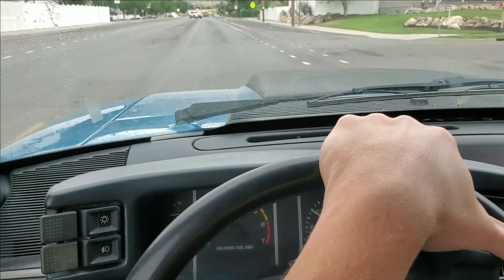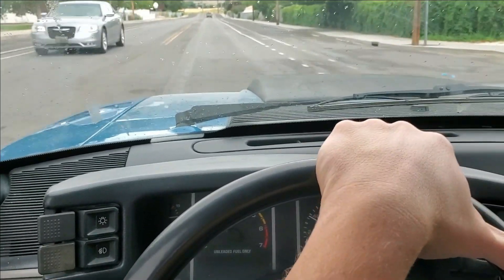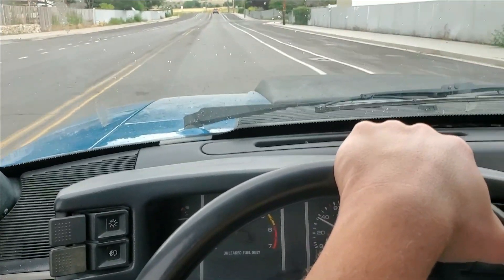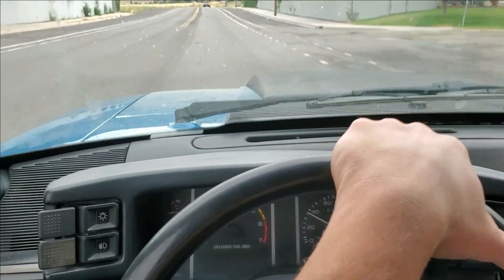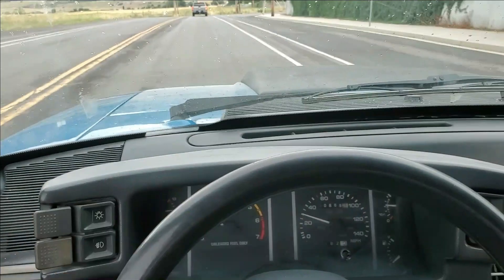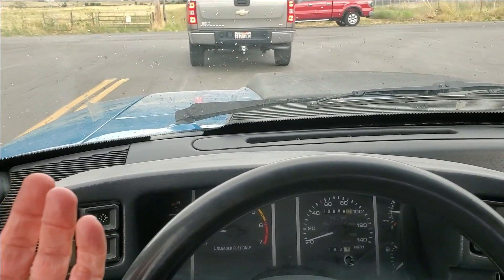This is just running in default limp mode — I don't know exactly what they call it — but it's basically a mode that when it loses connection to the CAN bus, which is basically your whole computer system, everything in the car, if it loses that connection it goes into a default mode which runs the pump at 70%. It's kind of to limp you home to get it fixed or whatever.